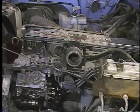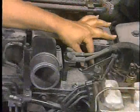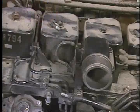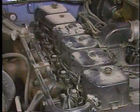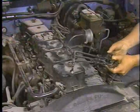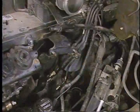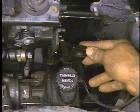Now remove the oil dipstick and the top engine cover. Next, remove the four bracket bolts at the top of the manifold holding the front and rear fuel bundles. Then disconnect the fuel tubes from injectors using the injector fuel line socket. After disconnecting the fuel tubes at the injectors, remove the fuel bundle assembly for injectors one, two, and three. Next, swing the rear fuel bundle down to gain additional clearance at the rear of the pump. Now remove the top two bolts and the bottom bolt from the pump support bracket, then loosen the remaining bolt and swing the bracket rearward.